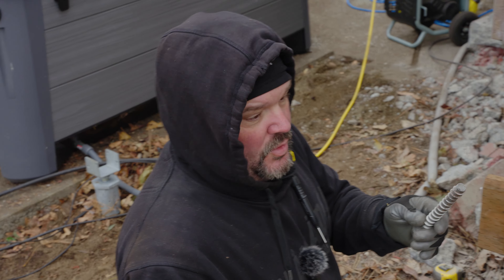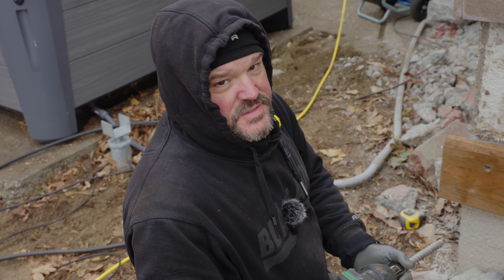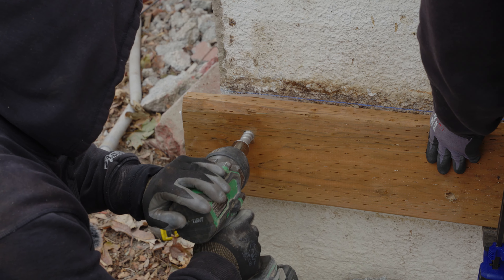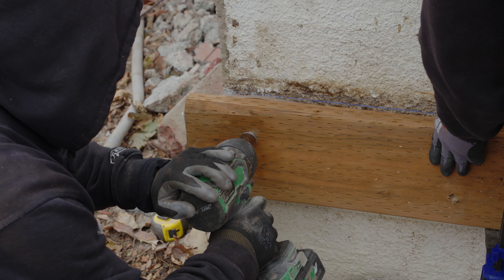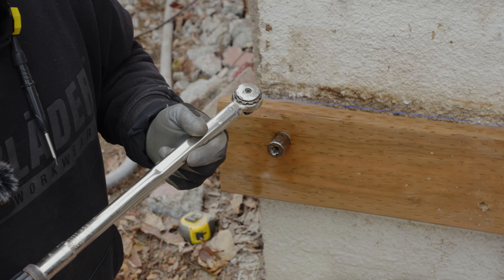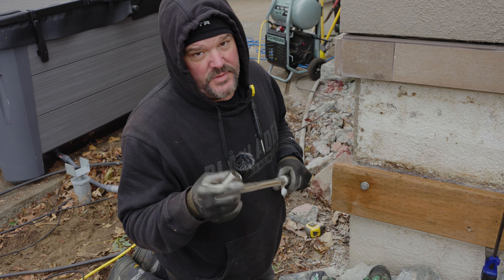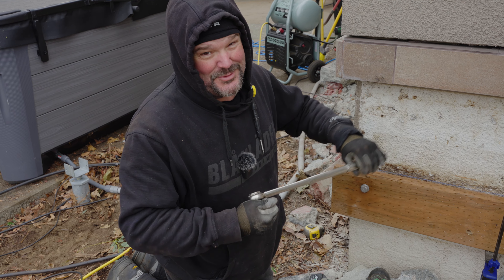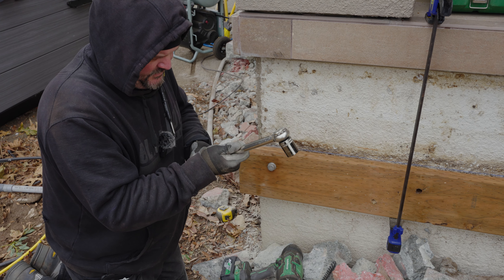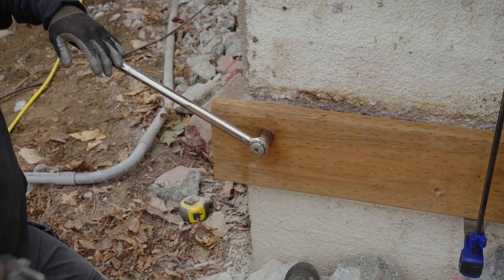We're going to take our Titan bolt and get it almost all the way in but not quite — we'll get it until it's snug and then use a torque wrench to finish installing it. I believe I already had this set from last time. We don't have an impact-rated socket today, so sorry about that. It says 65, so I'm going to set my torque wrench to 65 foot-pounds and finish snugging this up — as soon as it clicks, we're tight enough.